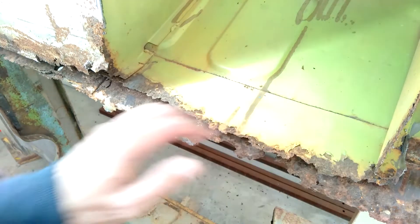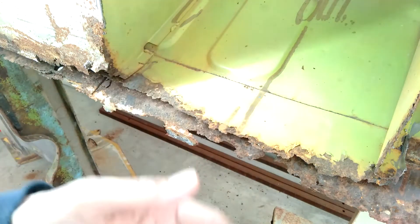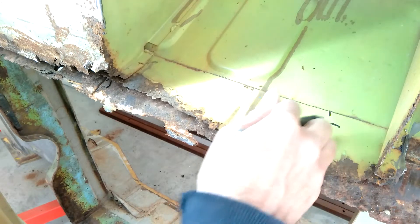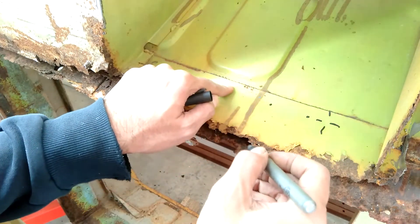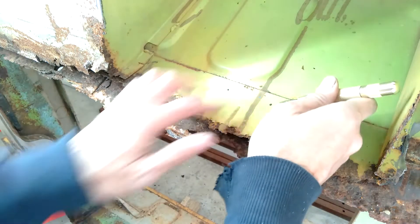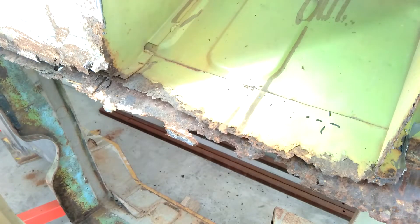It can be a bit tricky trying to locate spot welds. Where it's nice clean metal it's relatively easy to find them because what you're looking for is like a little crater, a little indentation, and that's where it will be. A useful tip is to just do that - mark it - and if you're going to drill them just put a little dot, then go along with the punch and center punch them. I like to use one of these punches - it helps the drill bit get into position and stops it from jumping around and sliding around.